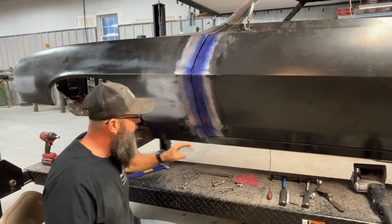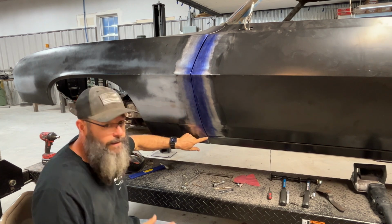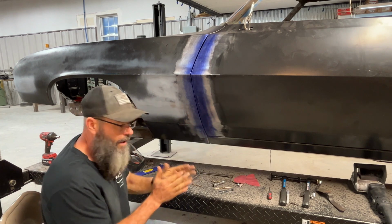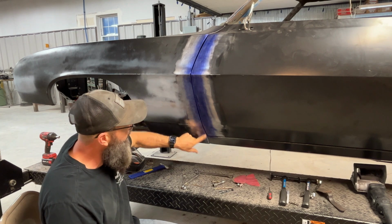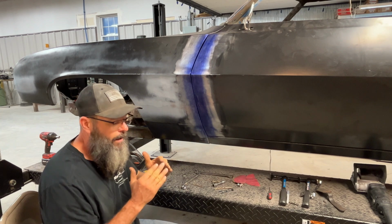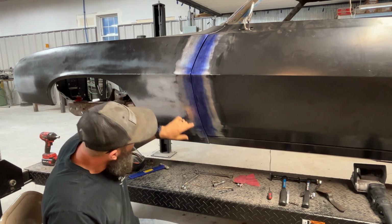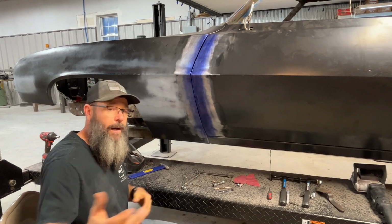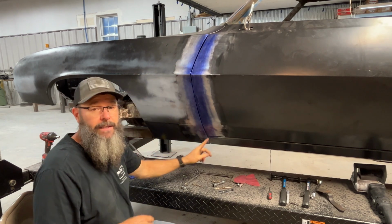And the only thing that I do for sure see, the fender patch, and I had this issue on the passenger side as well, this edge has a lot more roll to it, and it's not as crisp as the original fender edge. So I will come in here and build this edge up and make that a lot sharper edge. And like I said, there's areas that I'll have to open up. So anyway, I'm gonna reset the camera, zoom in, and then I'll start marking this, and then you guys can kind of see what I'm doing.